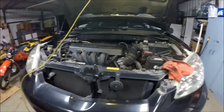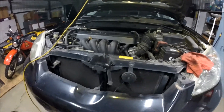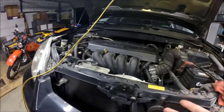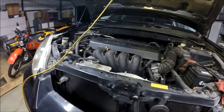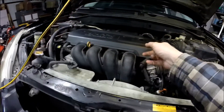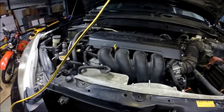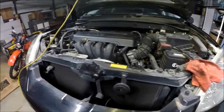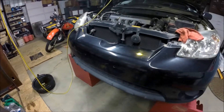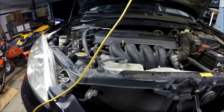Start the car up and let the oil pressure come up — let it run for about 30 seconds to a minute. Then turn the car off on level ground — I'm not on level ground here, so I'll have to pull the car down to check — pop the hood and check the oil. You'll probably need to add that other half quart. Just check your dipstick. There's nothing really complex about this job — I think you can do it. Just be safe about how you jack the car up, and make sure it's secure before you get underneath.